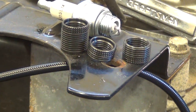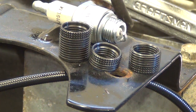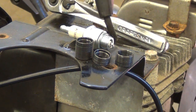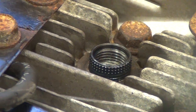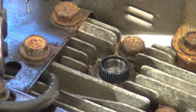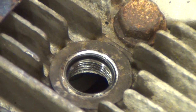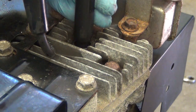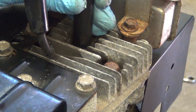This isn't something I'd do every day and I wouldn't recommend it, but in this case I didn't have a choice. With the kit they give you three insert sizes — you can see there's threads on it and then there's a little knurled pattern. You hand-thread the insert in, and then they have a tool — just a round bar — that you put in there and slam the hammer down on a few times. What it does is push the knurl out into the head. Here's the tool — you can see I'm giving it a couple of taps with the hammer.